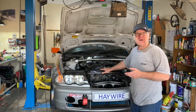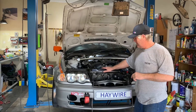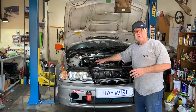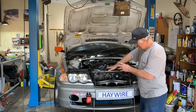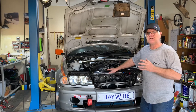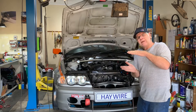Fortunately the front timing cover is only held on by about 8 to 10 bolts and is easy to remove once the engine is out or at least the cylinder head and sump are off. We'll do it engine-in-car, which means removing the belt cover to access bolts through the head into the top of the timing cover, removing the crank pulley at 420Nm, and getting the sump off. We're going to see whether we can just loosen the sump and drop it slightly onto the subframe to remove the clamping force locking the timing cover in place.